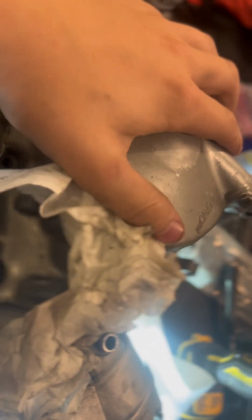It's all metal shavings, dude. I'm not sure if it is a piston. I mean, the piston looks fine, but like, who knows? It could be the very, very top of the piston, you know? Because, I mean, if it's locked up, I don't know if it would be the piston. Because this shaft in here where the clutch is spins freely. I'll put it in gear, it still spins. But the only thing that doesn't spin is all of this right under here, right under this water pump. That's the only stuff that doesn't spin, because that goes right to the crank. Because this pump, when it fires up and the crank is going, that's what activates that.